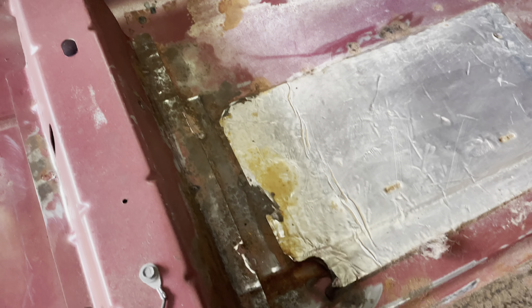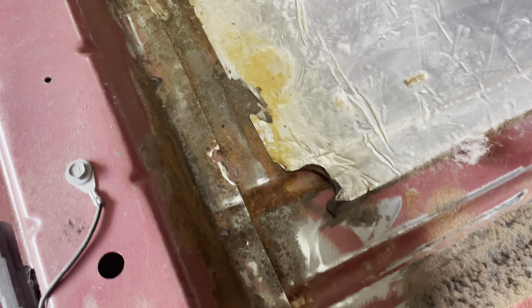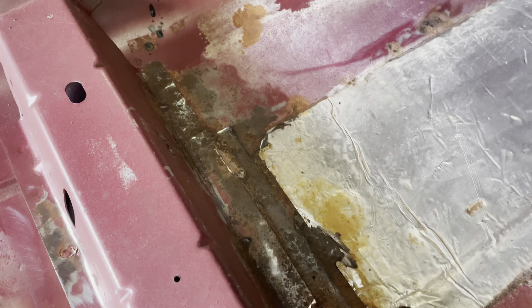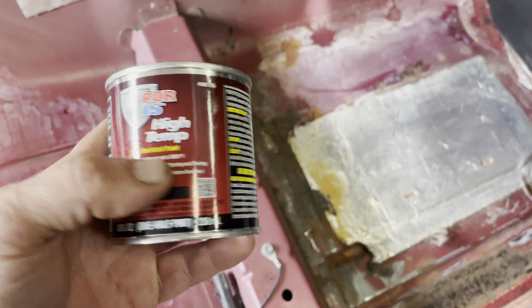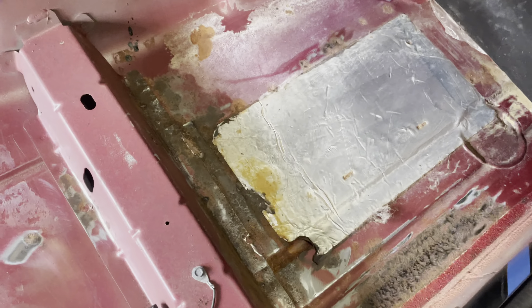Addressing the rust in the floorboard — what we've done is taken a scraper and knocked off the top of all the loose rust. We've taken a Scotch-Brite disc on a grinder and knocked off the top of all the rusty areas. There's a little bit here under the passenger seat, a little bit back in the corner underneath the back floor carpet, and of course this big area in the front passenger floorboard. This thing has sat outside — I'm not sure why it had water in here, unless maybe they had a broken window at some point. When I pulled the carpet out, it was not wet. We've got some POR high-temp paint, and we're going to cover these rusty areas and proceed with getting the carpet back in.